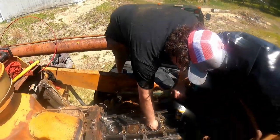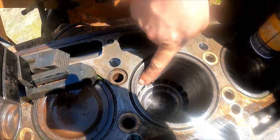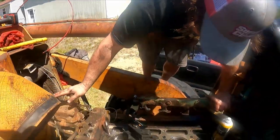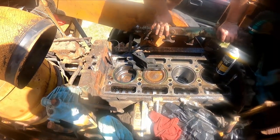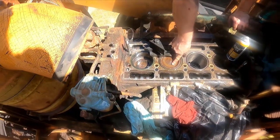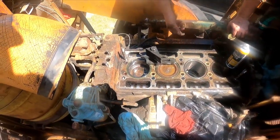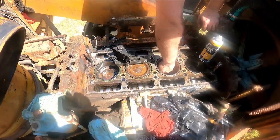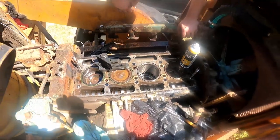We just got this cylinder to the bottom - this is our worst cylinder - and honed it up. You can see there's a lot of dark spots in the cylinder bore, and really the worst of it is just right here where the ring was sitting. It absolutely is not gonna have great compression on this cylinder, but as long as everything else works, we'll come back and might even do a full in-frame rebuild in the middle of a field. Now we're gonna crank this one down to the bottom - these two are clean enough that the hone stone will do more harm than good. Because of the ports in it, I know I can flush everything down into that area and it just drains to waste, so I'm not flushing hone grit into places it shouldn't go. There's definitely some pits down low, but there's nothing I can pick up with my fingernail except the top ring. The ring at the top means these are pretty worn anyhow.